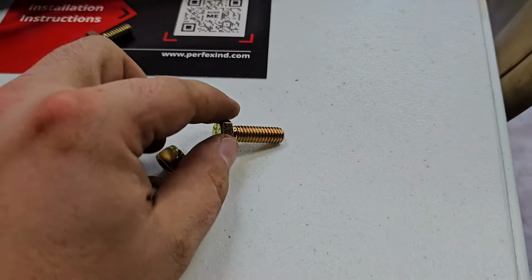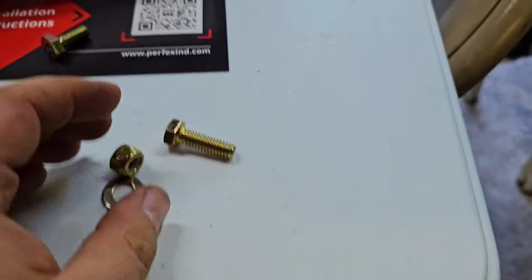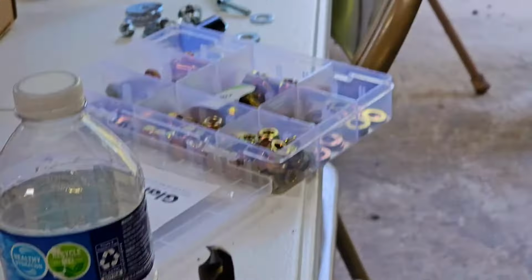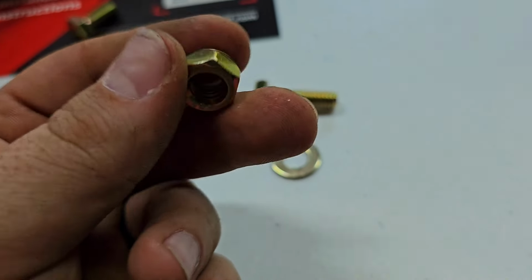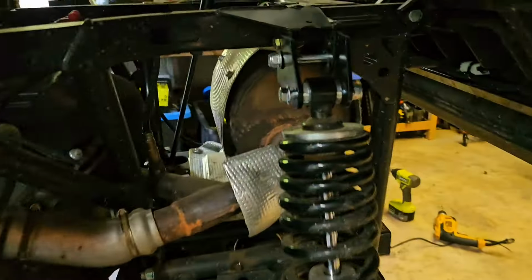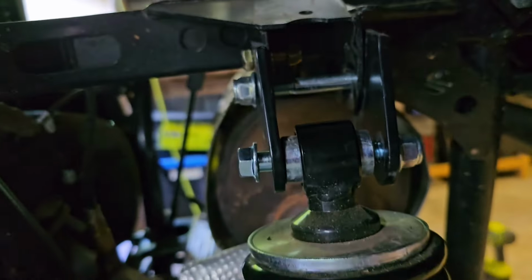All right, in the extra holes that we drilled, we're going to take our grade 8 bolts. These are 5/16. I'll leave a link in the description where you can get a whole kit of them, like I've got. They're really not expensive at all. We're going to feed it through, put a washer on it, and then I've got some nylon nuts that I purchased separately that I'll put in the description as well. When you do it, it'll look just like that. This is only in here temporarily. I'll show you how to do that with the spacer in just a minute.